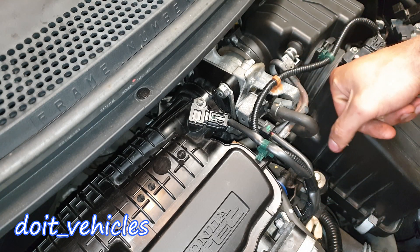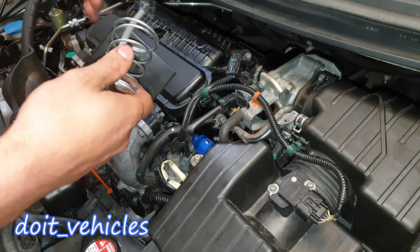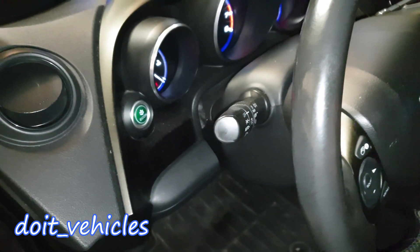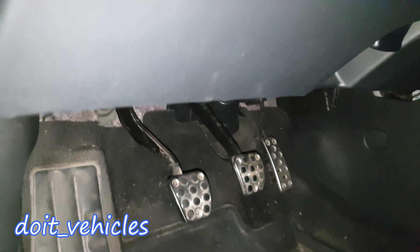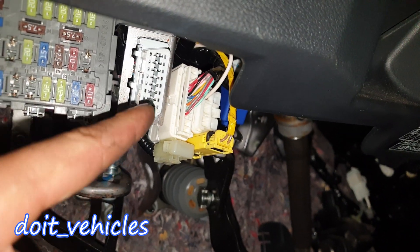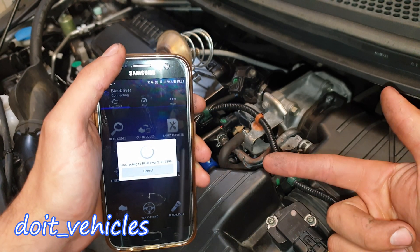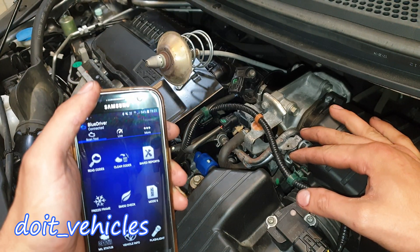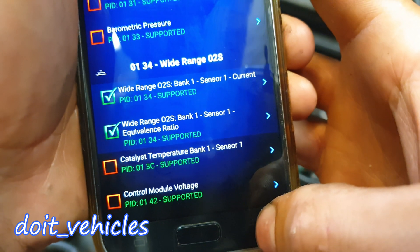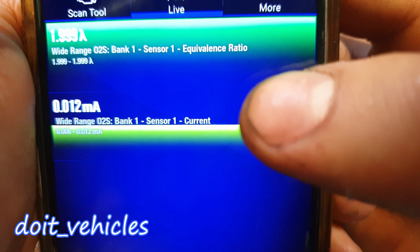That's pretty much all you can do with a voltmeter on this air-fuel ratio sensor. Now in order to read whether the sensor is active and sending a signal to the PCM, I'm going to place it on a support, plug back the connector, and with the key in the second position make sure you have enough battery on the car. Down here you'll find the OBD2 port next to the fuse box — just plug in your scan tool. You'll need either a scan tool or a voltmeter that can read milliamps to read the signal. On some scan tools you'll also see a voltage which will be flat somewhere between 2 and 4 volts while the engine is running, but on this scan tool you can actually read the mA, which will change depending on the air-fuel ratio.